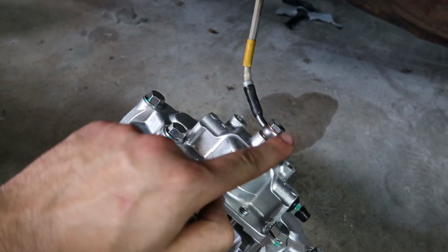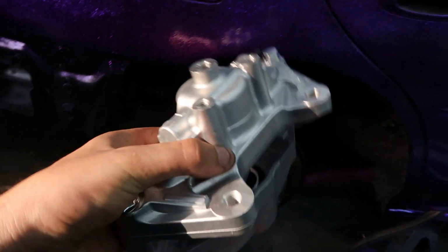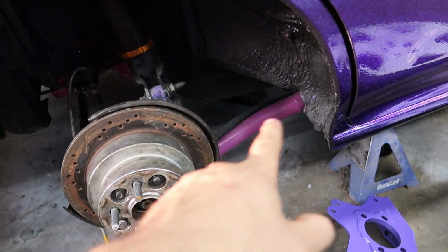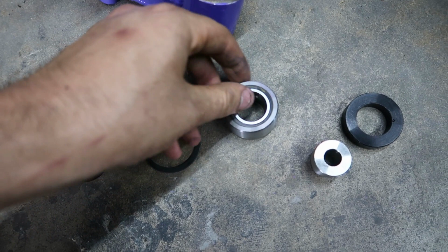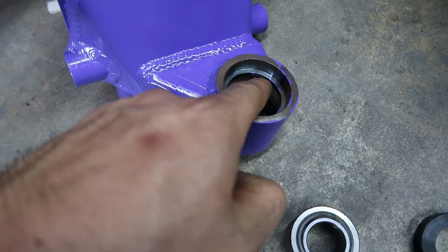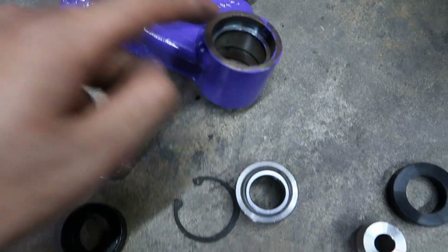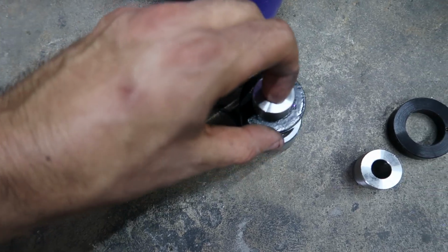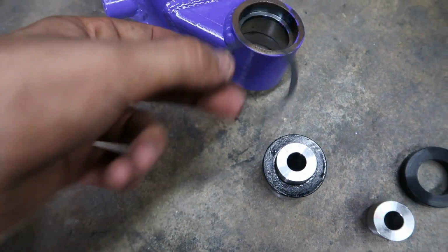So I saved some modifications on the normal brake pedal brake caliper. I'm still going to need to make custom lines and everything for the hydro second rear caliper. First, I got to put the rear lateral arm bushing in right here, and this is a Heim joint, so this does wiggle a little bit. And if we look here, there's a lip, so we're going to need to push it in from the back all the way up against that lip, and then we can put the other pieces in, because that'll go through there, fit in there, yada yada, and then close it off with the snap ring.